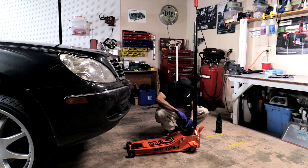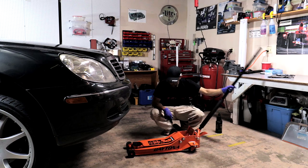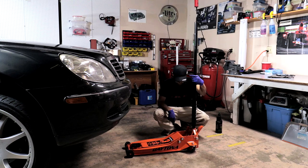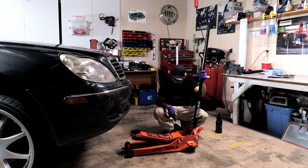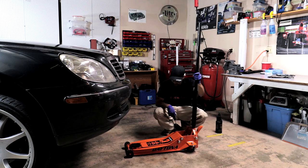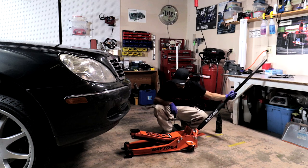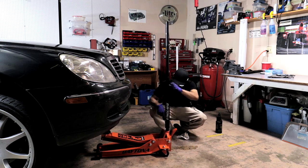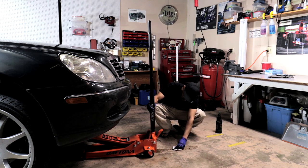And once you extend the piston all the way back, more fluid can come out. Or if you do a lot of rapid pumps, the fluid can come out as well. So here I'm just dialing all that in and getting everything sorted just right. And it looks like I have everything the way I want it. It's still lifting a little bit, but what I did later, which is not in this video, is that I removed just a little bit more fluid, and that helped a lot. And then it was able to stay down even while I was moving the lever.